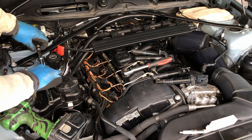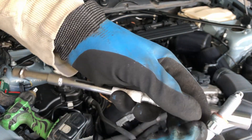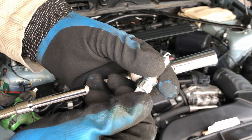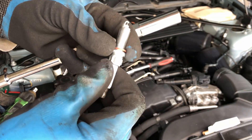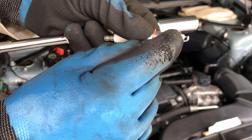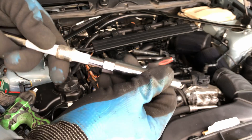Time for the new ones. I started at the back — cylinders five and six needed the extra little extension bit since it's harder to reach. I was looking for this anti-corrosive compound — it's a gray stuff with some grit that you wipe on the threads. It's definitely a good idea, but I think I used it all on my Silvia. Running E85, I've heard the thread ends can rust and make the plugs very difficult to get out, so I'll need to get some for next time.